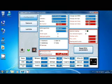Let's try it. Now I turn off the vehicle, and I will start in emergency. Okay, let's start the car in emergency, and as you see here, we are already on gas, and the number is 4 instead of 5. So it means that 4 emergency starts are left. To restore the maximum value, press the reset button.